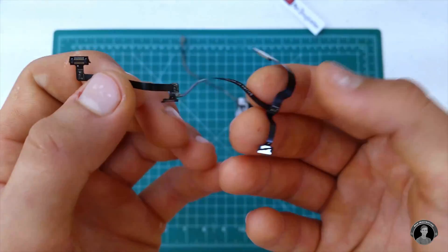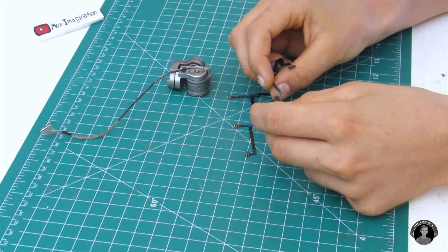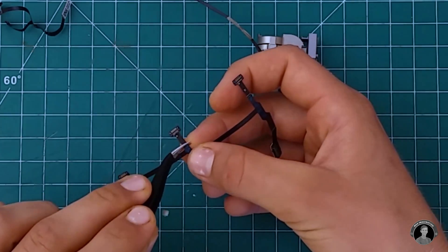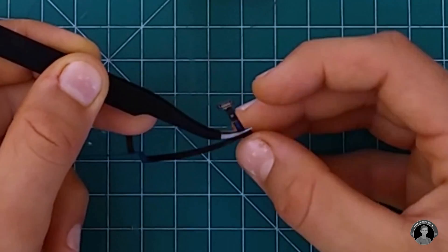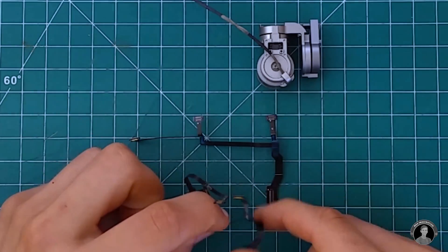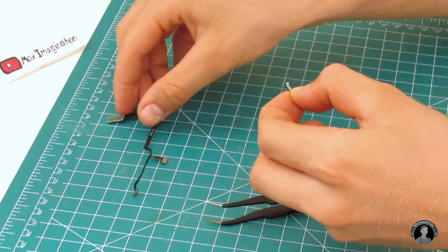Here's the old gimbal flex cable, and to the side is the new one which we'll be replacing it with. It's very important that you use the old flex cable as a reference to its bending points, because you just can't trust the marked points on the new cable. Having the new one adapted accordingly, it's pretty much ready for installing. And just in case for the future, let's remove the code sticker from the old one and stick it onto the new cable's main connector.